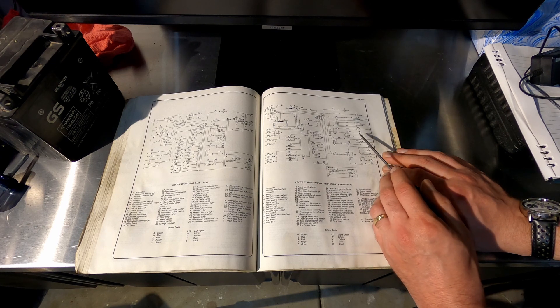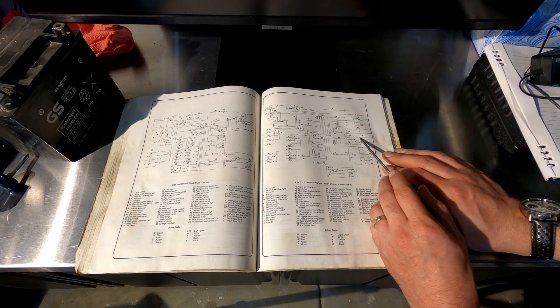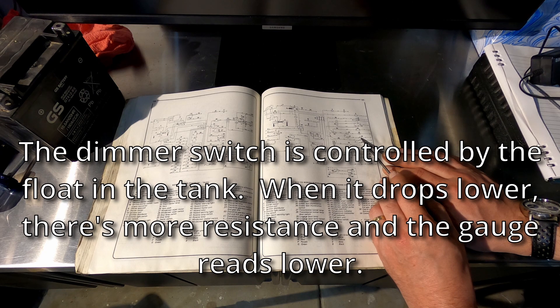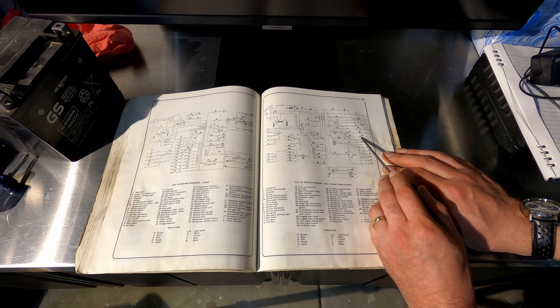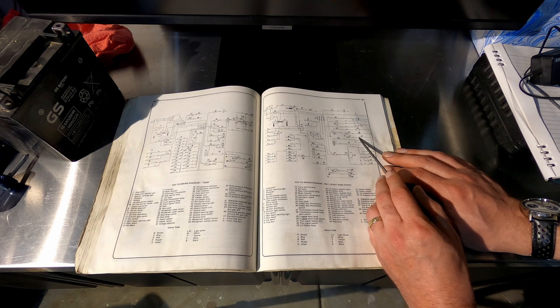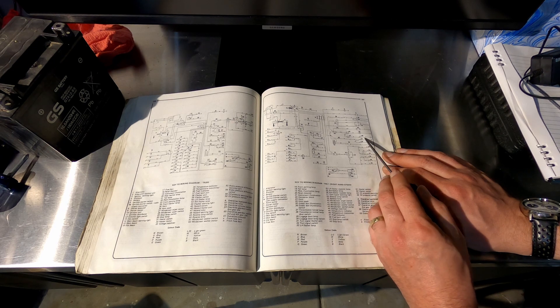The way the fuel circuit works: you have power going into the gauge, it goes through a variable resistor — kind of like a dimmer switch on the wall — and then it goes to ground. If that dimmer switch is turned down, the gauge is going to read lower. This is really just a voltmeter. If your fuel gauge isn't working at all, you want to see: are you getting power to the gauge? Is the power going from the gauge to the sending unit? Is the sending unit grounded properly? That's how you diagnose it — with either the voltmeter or the test light.